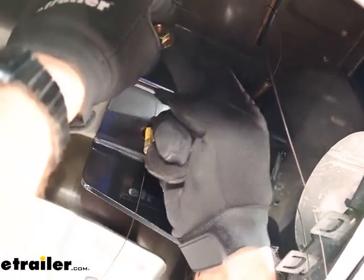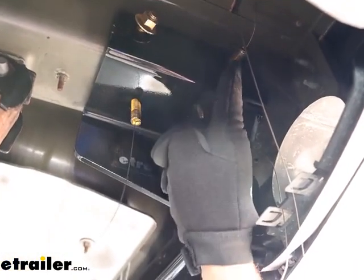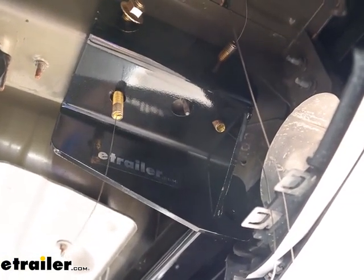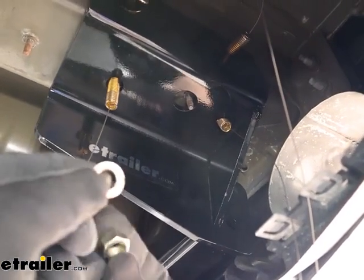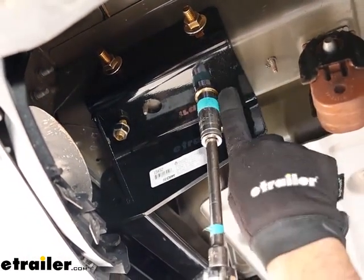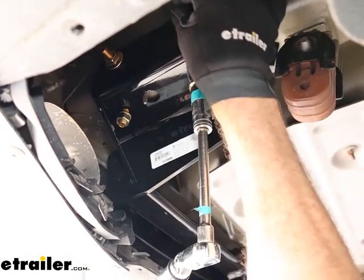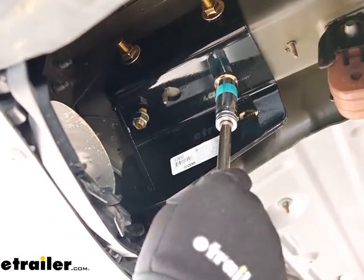Take one of your flange nuts. This bolt, this one, and this one get the regular flange nut. The one on the inside closest to the gusset gets the split washer and the regular nut. With the nuts snugged up, torque these to the specs in your installation manual. Torque the ones on the bottom first — that will raise the hitch up into position, and then the side ones will line up a little bit better. Make sure you do this on both sides.